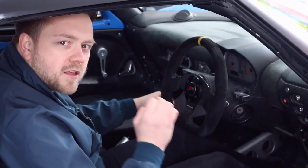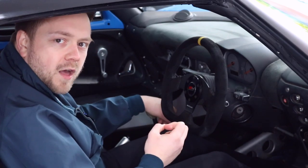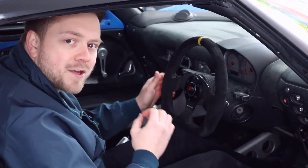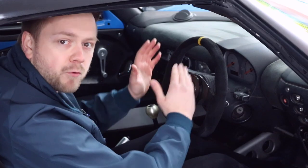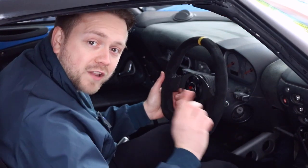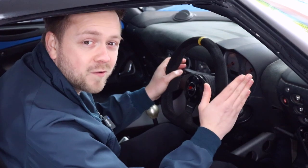Any crashes or lumps or bumps going over speed bumps or potholes isn't normal — but it's not the end of the world. It could be a tired shock or a worn bush, and these are good negotiation points with the seller. One of the last things to try on the test drive is the clutch. Get yourself to an incline at around 3-4,000 RPM and floor the throttle. Make sure the RPMs climb proportionally to the vehicle speed — if the revs just shoot up, a new clutch is required. Don't let the seller pull a fast one; get money off or walk away.